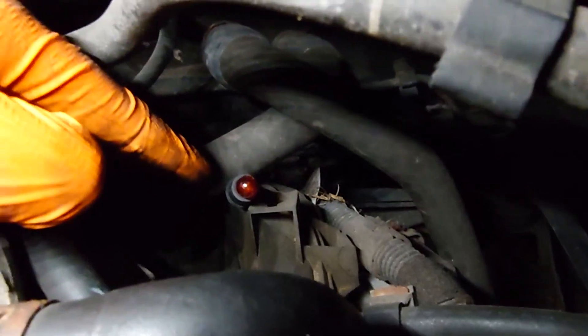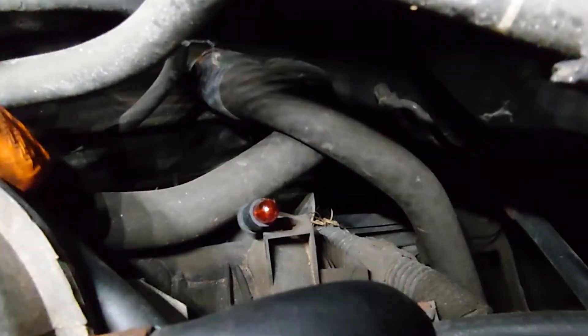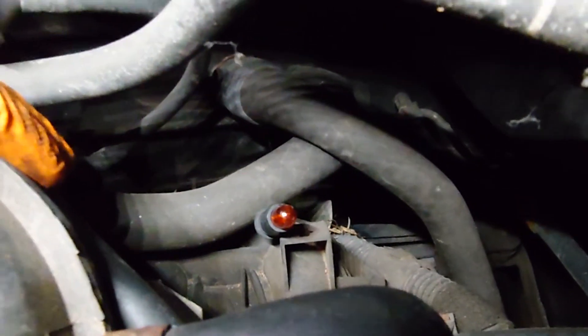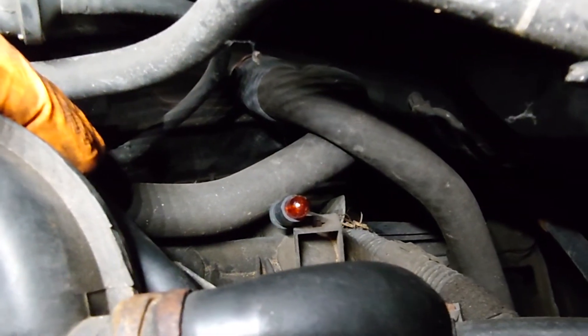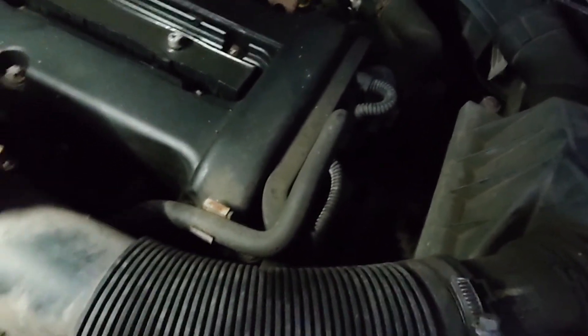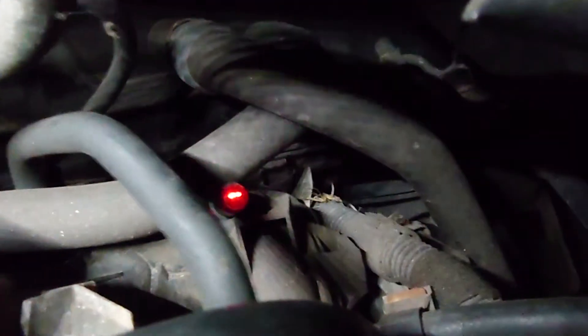What I've got set up here is just a bulb and a bulb holder — just a little 501. You can go a bit heavier if you want with a bulb size. That is back-probed into the wiring harness side of the vehicle, so when we start the car up we should see that flashing on and off. Just start the car up — you can hear that exhaust blowing.